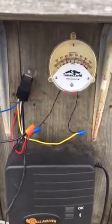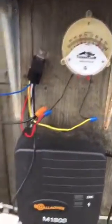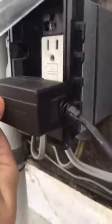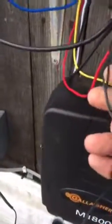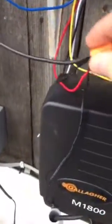For several years we supplied power to the siren using a 12-volt automotive battery, but this year I realized we have an outlet here — a service panel with 120-volt supply. I got a standard transformer, 120-volt AC to 12-volt DC output wall plug, and plugged it in. I cut the plug ends off the wire and used a multimeter to identify the positive and negative sides of the output wire.